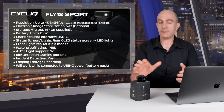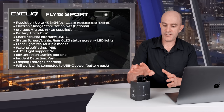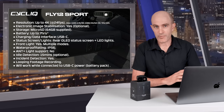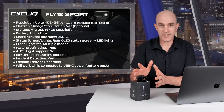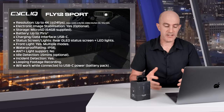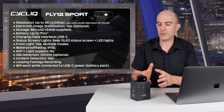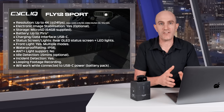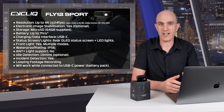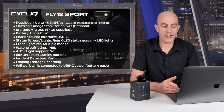It also has incident detection: more than 30 degrees in one direction or 60 degrees in another for more than five seconds, and both the current and previous video recordings will be locked and not overwritten. The scenario here is that if you're involved in an incident and separated from your bike, that footage gets saved. The unit also has looping recording on by default — when the SD card fills up it overrides the oldest footage first, but not the locked footage. It will also work with a USB-C cable plugged into a power bank.